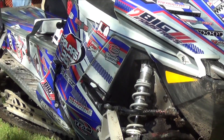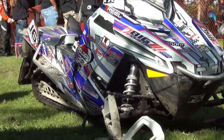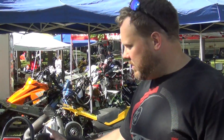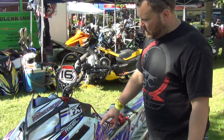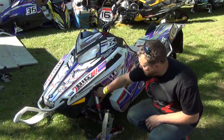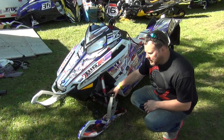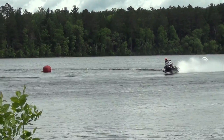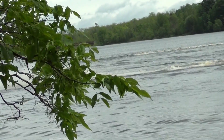So what you can do is take your normal snowmobile that you ride in the winter, do just a tiny bit of clutch work, and change the jetting. This machine is fuel injected, so I don't have to change any jets — the computer does everything for me. We seal it up by putting a little bit of silicone around where all the belly pans meet to keep some of the water out. And that's basically all you have to do to get it to go across water. It's a very simple process — it can be done in one night.